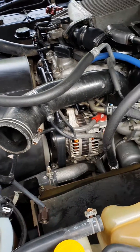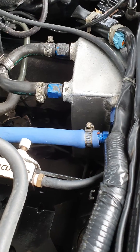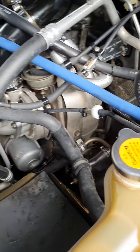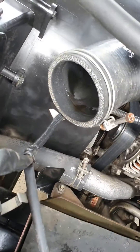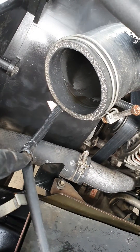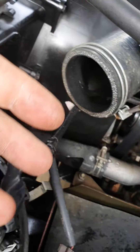This thing's a ZD30 — they've got a bit of breathing fumes again, and it hasn't got a real catch can on it. Definitely get a good new one; I'll be talking to the customer about putting on a proper one, because in the end it's a false security. You can still see the fumes — we're about a minute into recording here and it stays and keeps coming.